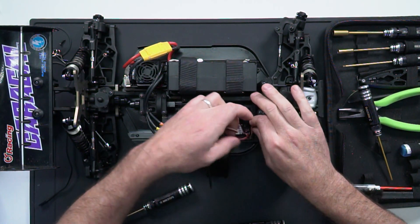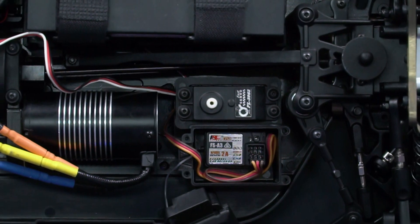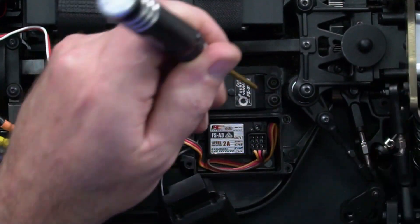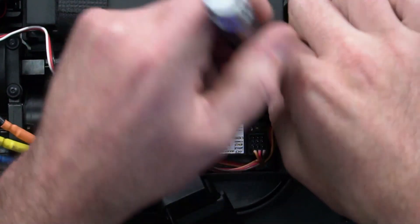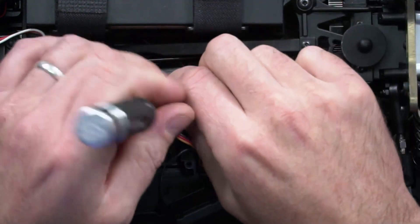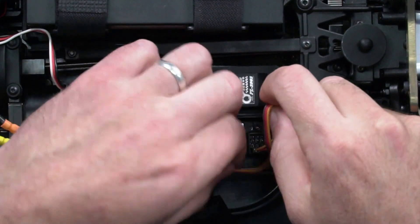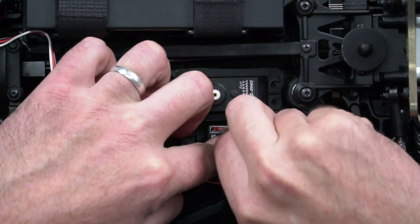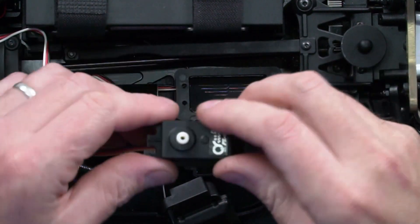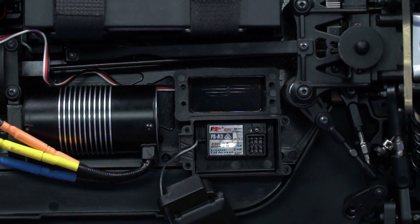Beautiful little box here. I've got the plug here in channel one — we'll go ahead and unplug that. You can see right here I have unplugged the servo. Now hopefully it's just a matter of lifting the servo out of position. I might have to take it off from underneath to get the wire out, but let's see. And that's coming out really nice — this is one of the easiest servo replacements I've had to do, a testament to a well-engineered car.